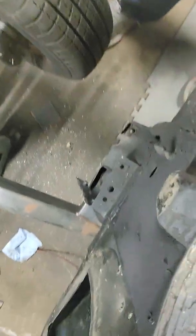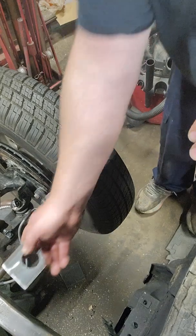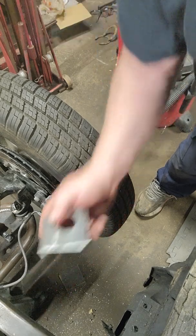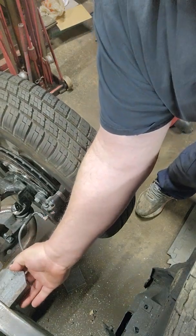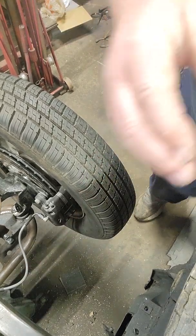Basically what I did: I set this against the frame and up against the floorboard with the small pilot hole I drilled, then ran the drill up through the bottom through the floorboard to make my hole so everything lines up. Next I'm going to take a moment and clean off these edges here — smooth off the jagged edges — and then go ahead and drill the inch-and-a-half hole to finish this up.